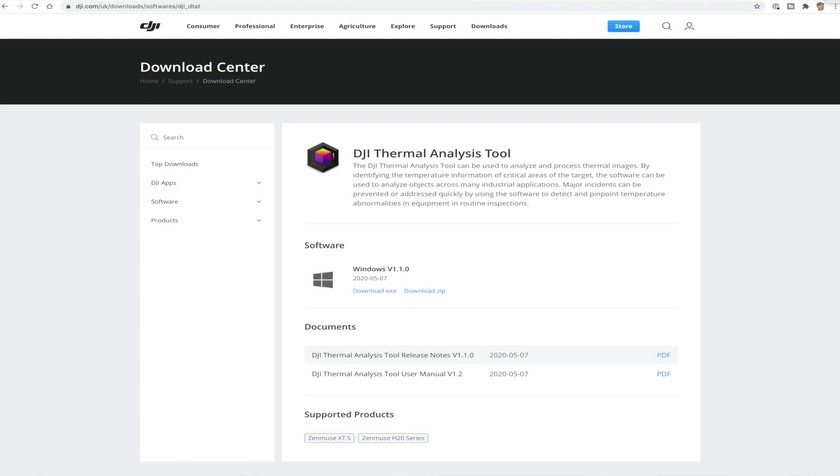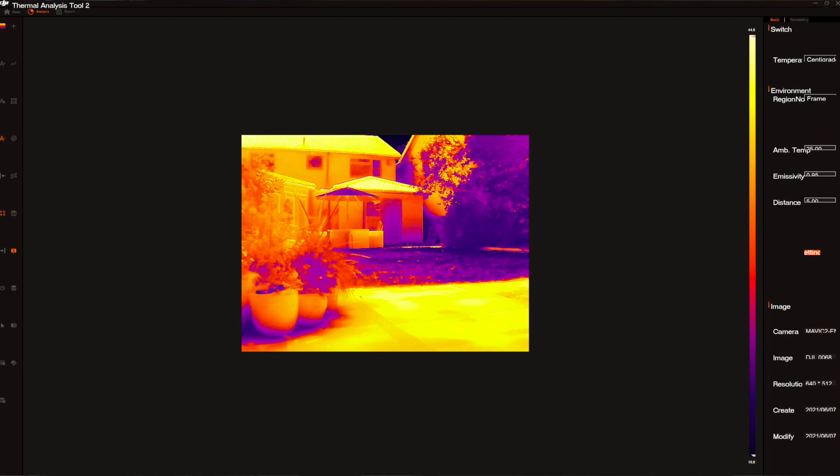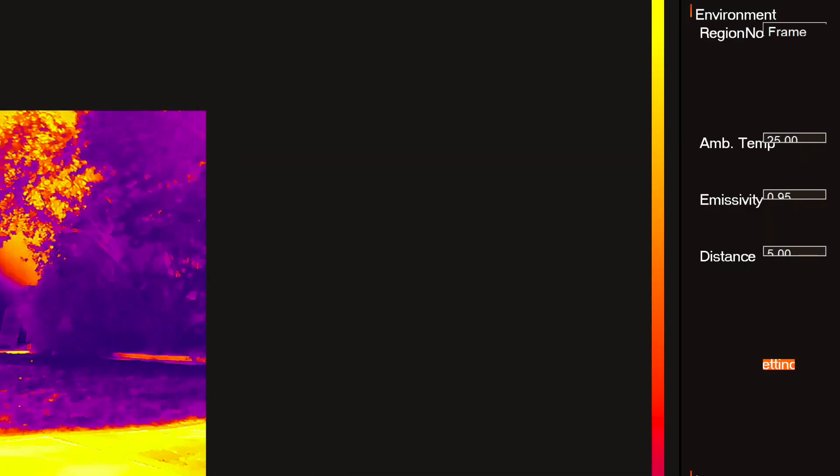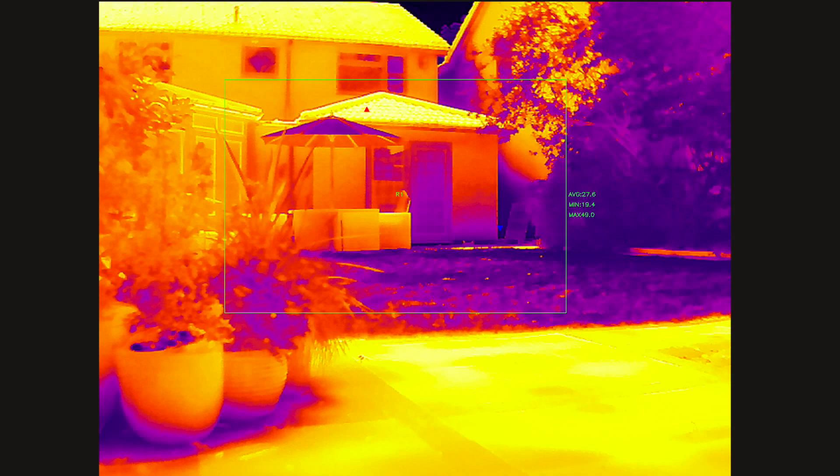DJI provide a proprietary thermal analysis tool downloadable from their website, but it's Windows only. People are sometimes confused that the IR image on the SD card is just a JPEG — but that's just the file extension; all the radiometric data is embedded in the file, so you can load them up, find and measure temperature hot spots, averages for an area, and so on. However, it's not industry standard, so thermographers won't like it. The implementation feels very unfinished — program fonts are wrong, text overlaps edit boxes, which is a schoolboy programming error. You can export marked-up images and create a Word format report, but that just crashes with a fatal error. It feels like this was rushed out and not properly tested.